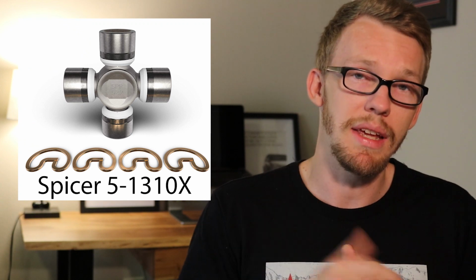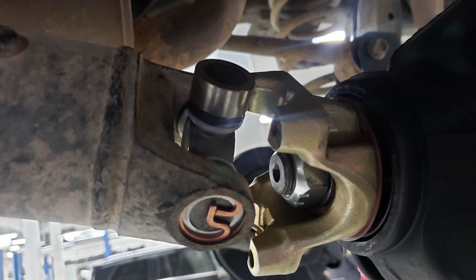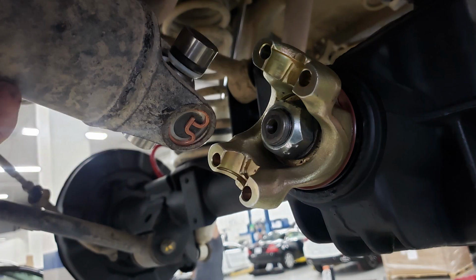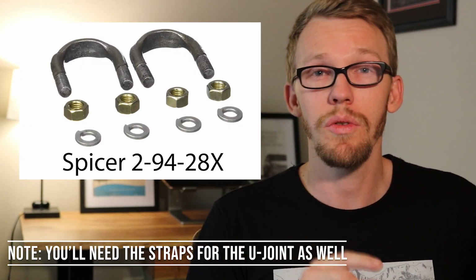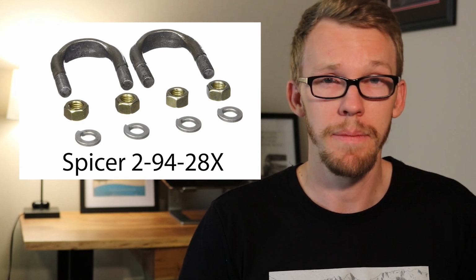When I had the drive shaft out, I replaced the U-joints. That was a perfect time to get those new U-joints in and set. One issue I did have come up when I installed the axle back into the doozy is I found that with that conversion, the flange sits about 1 inch further away from the original length of the drive shaft. So I had to stretch it just a little bit more so it would sit into that conversion flange for those 1310 U-joints instead of using the Isuzu flange.